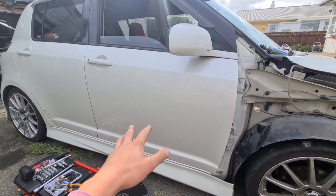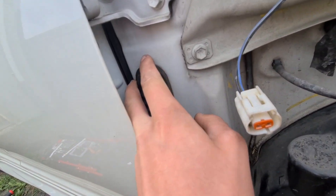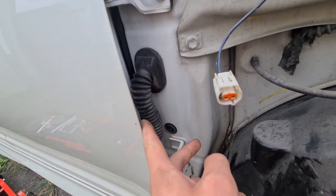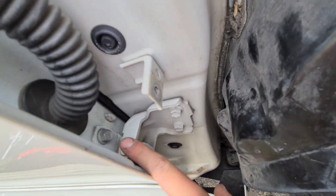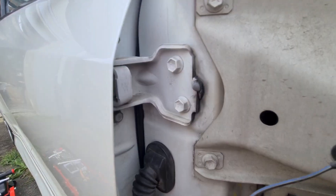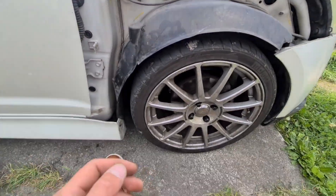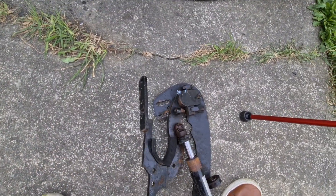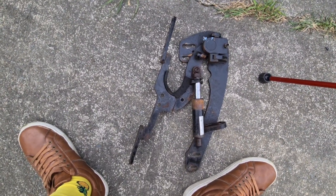The easy way is to actually leave the door on the car. This harness is an absolute pig of a thing to remove — I've actually damaged the one on the other side, but I think we can come up with a DIY fix to keep it in place. The bolts to remove the hinge are here: two bolts there and there, and another two there and there. Then they just drop off. This one mounts to the factory holes — two holes here and two holes there, though it only connects up to three of them on the other side.